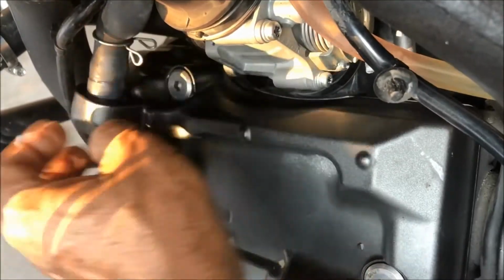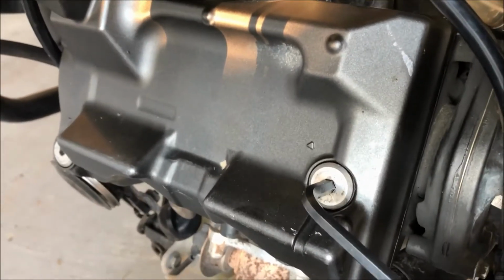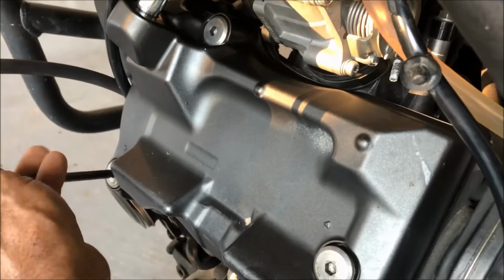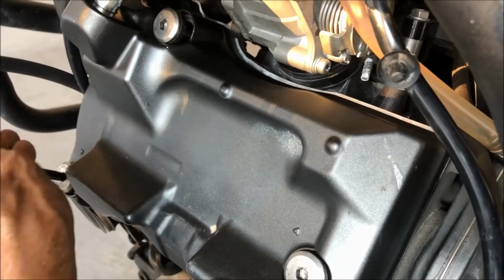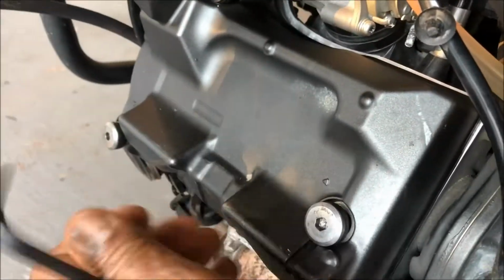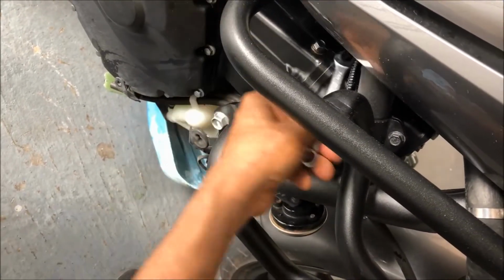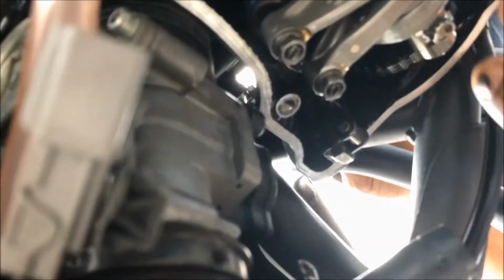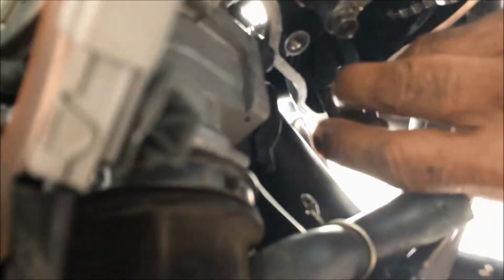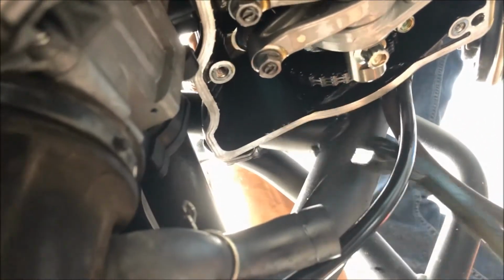We'd have to remove this hose, as well as these three bolts that hold the tappet cover. Okay. This screw. Now, when I open, I can take the whole thing out to me. Now this, just ease it until it comes out. Nice. Okay, like that. Something is getting stuck here. There you go. You got it.